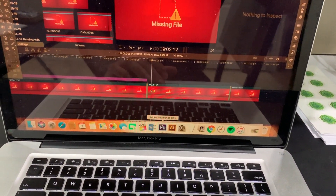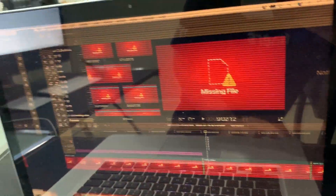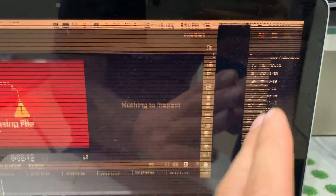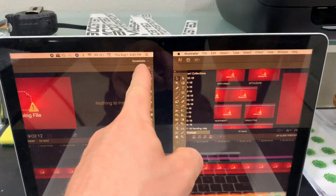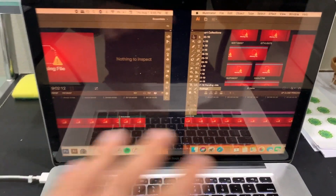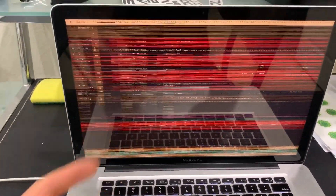All right, let's see how many programs we can open. We got Photoshop open, Adobe Illustrator, music playing — and that's all it took. You guys see that? See it messing up? That is not me doing anything — it is cooked. See all these lines? That weird bar that's supposed to be over here — the screen literally just moved itself. This is failure of the graphics card. That would normally be over there. So that is a cooked logic board, 100% hands down. This is the second time it's happened. The 2011 MacBook Pro — this is a 15-inch model, but they all do the same. It just doesn't know what to do with itself. Super fun, Apple. Thank you for making this so much fun.